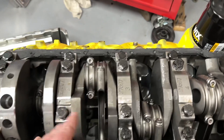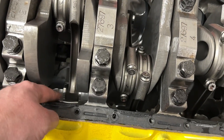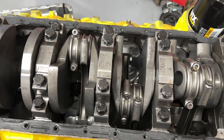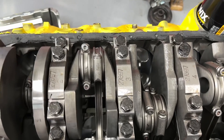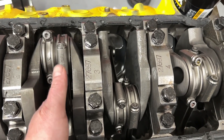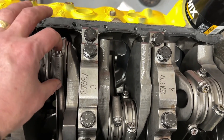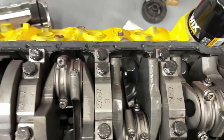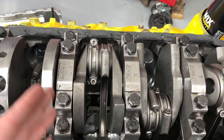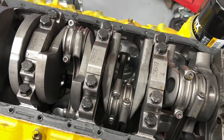You might ask why we did it. For the Engine Masters Challenge, we were trying to get the most out of it. This setup helps not unseat the ring — which makes more power — and having less friction also makes more power. It seemed like a win-win, and this is a smaller cubic inch engine anyway. The disadvantage is the small block Chevy rod — but the weakness is not the rod, it's the cap screw. And this cap screw is the same 7/16ths that's on a big block Chevy rod with ARP2000 material. So it's the same strength. The reason for doing it was: reduce friction, better ring seal, equals more power.